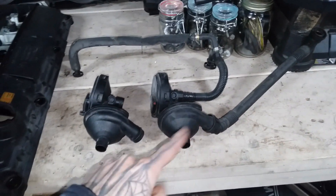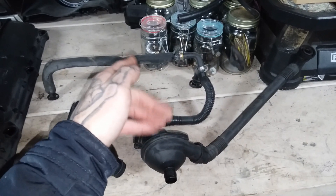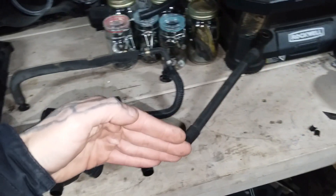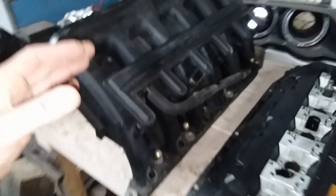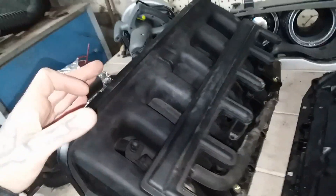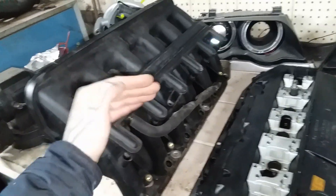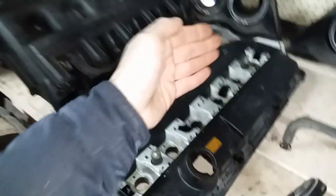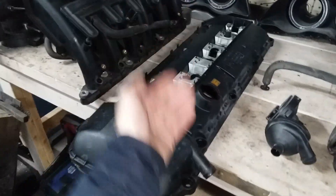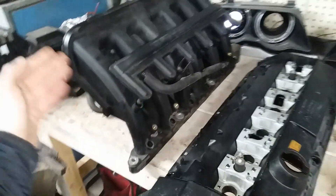Coming down, it's spinning like I described in the last video in the cyclone. It's spinning, getting separated, still sucking into the engine where it gets combusted. So it's constantly flowing in this direction while it's evacuating and processing vapors. Whenever you boost a stock CCV, whenever you boost one of these engines, obviously positive pressure — meaning air — is being forced in versus naturally breathing it in. This engine without turbo is operating solely by the vacuum created by the cylinders while it's running. It's creating a lot of vacuum as the cylinders are doing their thing up and down, creating a constant vacuum source.